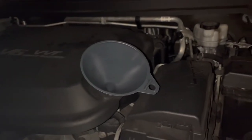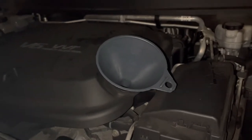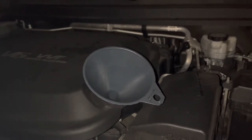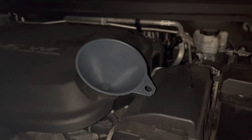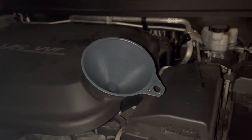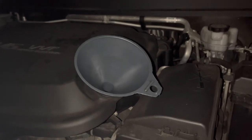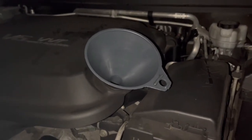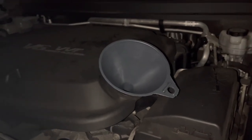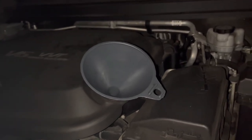You're going to fill it with six quarts of oil. GM calls for 5W-30 full synthetic and they want something that's DexOS rated. I always use Valvoline full synthetic, but as long as it's DexOS rated it should be good enough. The 3.6 calls for six quarts — different engine types might require different amounts. Always make sure you check your oil level with your dipstick and don't under or overfill it. Thanks for watching and we'll see you next time.